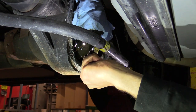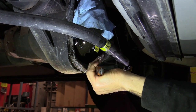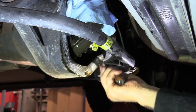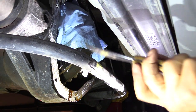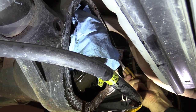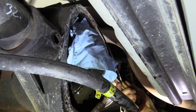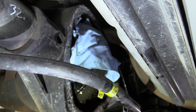We're ready to clean off the silicone from the housing flange. I'm using a good sharp gasket scraper. It's a fairly rough machine surface — it's got some ripples from the factory, which I think helps the silicone have something to hold on to. We're going to go all the way around and clean that up, trying not to get any of it inside. I've got it covered up on top so that keeps debris from falling in on your gear set. We'll get as much off as we can with the scraper, then use a roll lock disc made by 3M to knock off the rest.